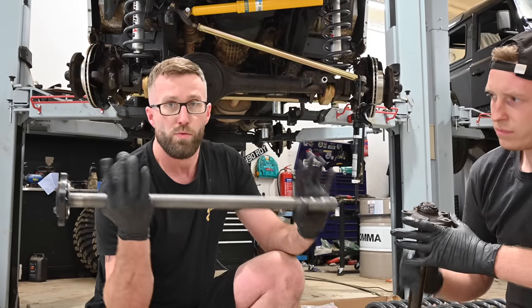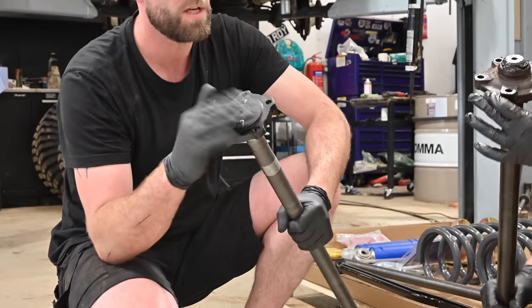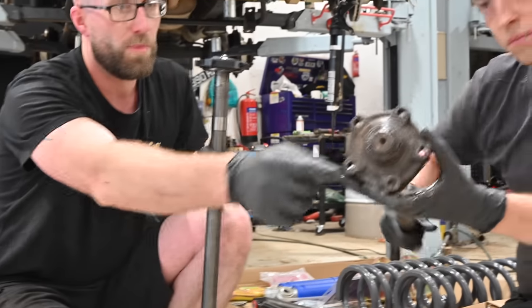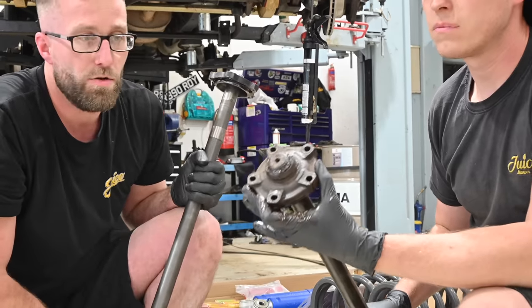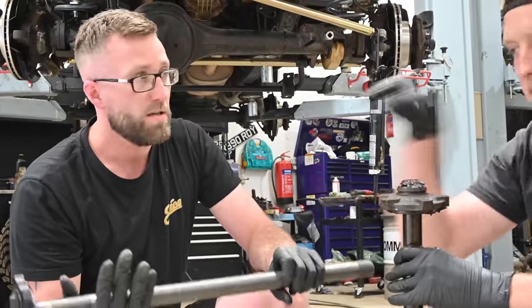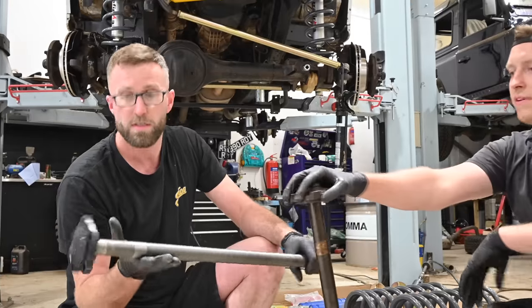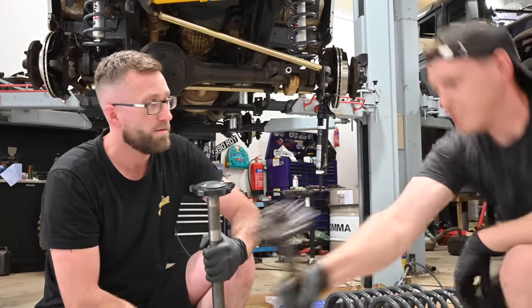Arms. We need new nuts and bolts. We're replacing the rear half shafts with these solid fixed shafts here. What happens is you get a lot of play in the rear shaft and the flange there, and it creates a lot of noise and slack in the transmission. These are a permanent solution, and the problem goes away and you never have to deal with it again, basically. Let's get them installed.